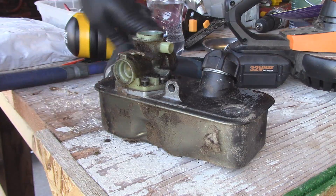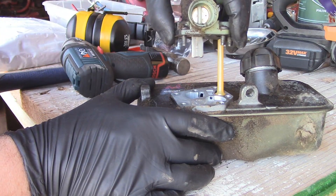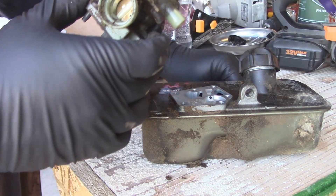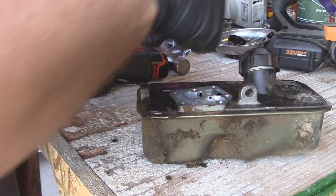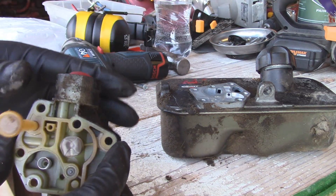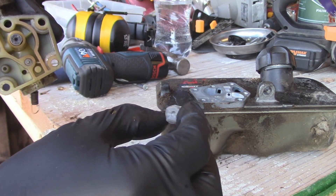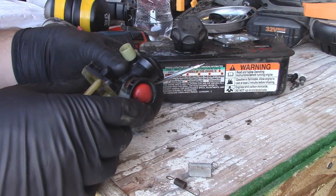Three, four, five — that's all of them. Just remove the carburetor like so. Looks pretty clean below there, but the diaphragm has definitely seen better days. I had a feeling the diaphragm was going to have to be changed, just judging by the age of the mower. I'll go ahead and spray this whole thing off with some carb cleaner, then reinstall the spring and the little filter. If they're not too clogged up — and this one's not at all — you can reuse them with no negative effect.